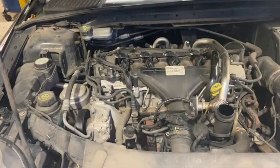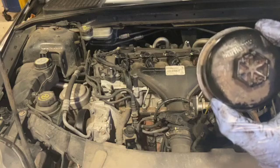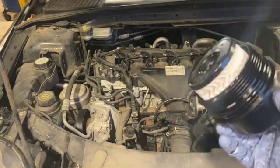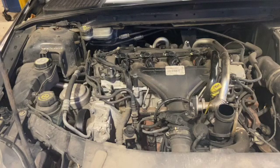All the work underneath is done now. We've got the vehicle back down and I'm just going to put the oil filter cap back on — the cap says 25 newton metres, which is quite a light nip. We haven't put the under tray back on yet because once the oil's in, we're going to run it up and leave it running on the ramp so we can check for leaks.